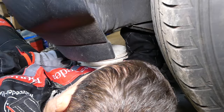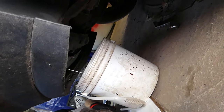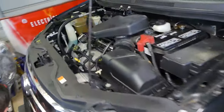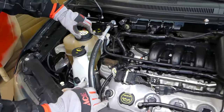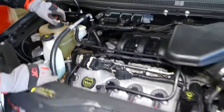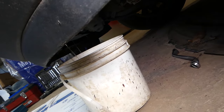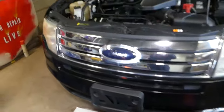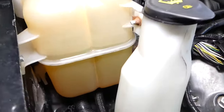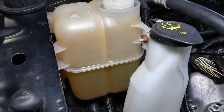Get it loose all the way and you can see the coolant's coming out. What you have to do next is open the coolant reservoir. Note: drain the coolant only when the engine is cold — if it's hot it can severely burn you, it can be under pressure and that could hurt you really bad. Once you open the reservoir cap it will come out even faster. Do not remove the plug all the way or it's going to come out everywhere and you won't be able to collect it. Let it drain for about 5-10 minutes — the coolant in the reservoir is already dropping, and it will drain from the radiator and engine as well.